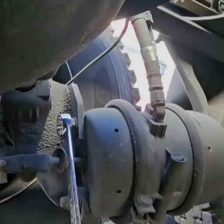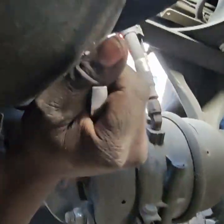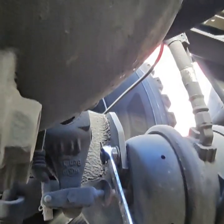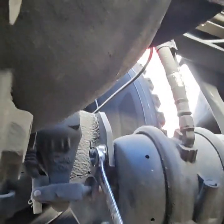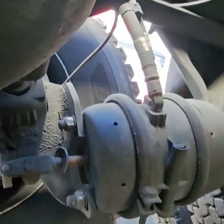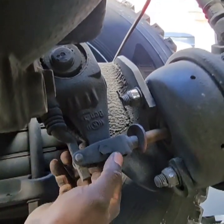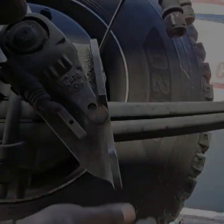Underneath the truck at the rear, just take off these bolts right here. This one is a bit difficult because you can't use a ratchet, so you have to use a manual wrench and take it off one thread at a time. Then you do this one as well. After that, take off the airlines and take off this pin for the slack adjuster — there's a front pin and a back pin. Then this thing is ready to come off.